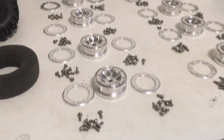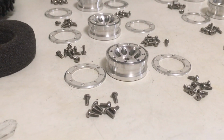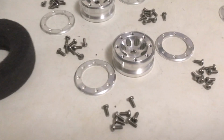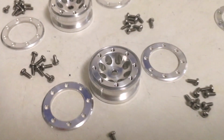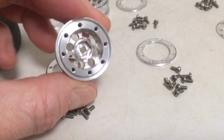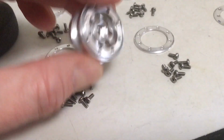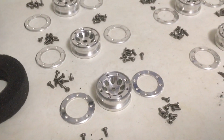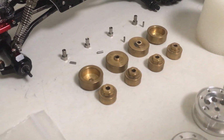And these come vented. They're all aluminum. One piece center, no ring. You've just got the two beadlock rings. And then you can see the bead seat is built in there. So just super nice. No hardware on the inside at the back. These are about a zero offset. So with that open backside, KINETIC also came out with these hex weight extensions.